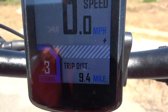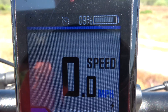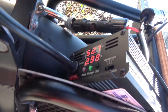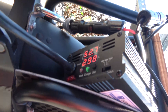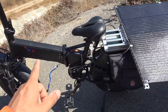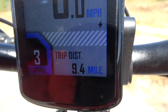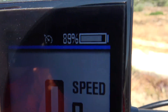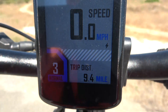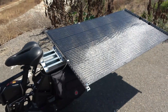At 9.4 miles, the battery state of charge is still 89% — which is incredible. The panel is charging at 52.7 volts, about 3 amps, which is about 160 watts. This battery normally only gives me about 20 miles, so at 9.4 miles I'm halfway, yet the battery is barely dropping. After just a couple more minutes it's back up to 90%.